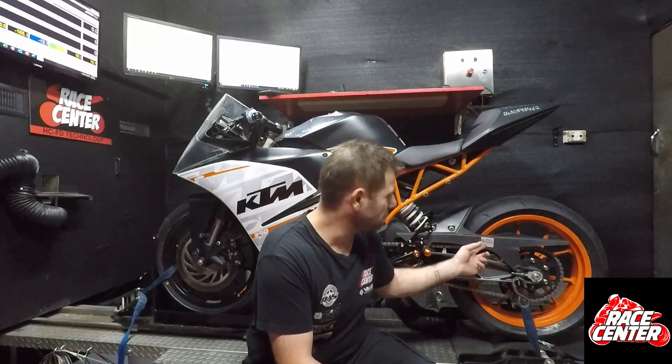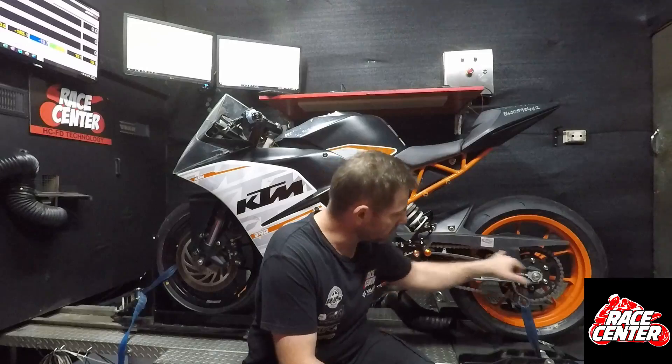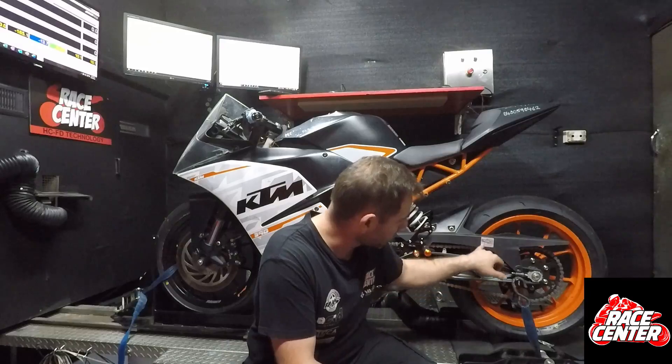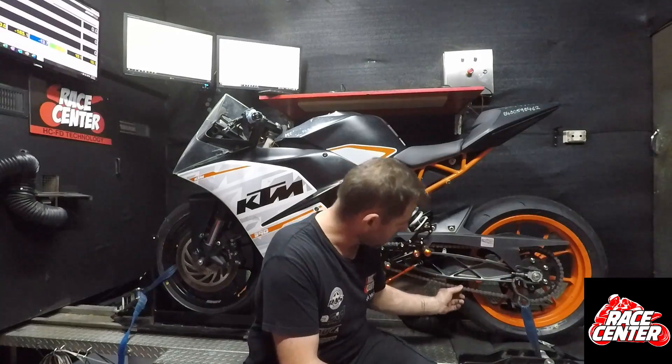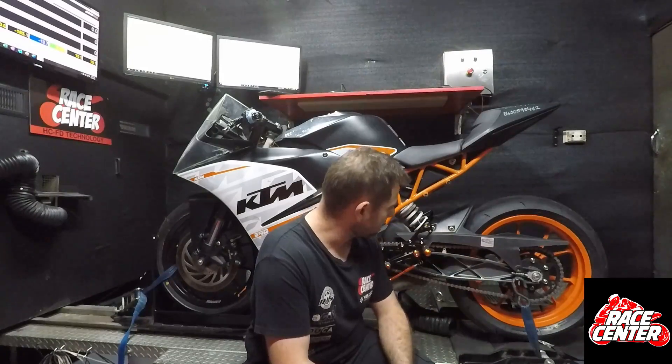You can see how this happened. It works in standard trim, but as soon as you start changing sprockets, any procedure that gives you a fixed reference point like this can't be used — you have to use how much slack you've got in the middle at the midpoint. We'll do another video later on about how to adjust your chain and do your wheel alignment properly, but just wanted to cover this because it's a bit of an odd one. Anyway, thanks for watching.